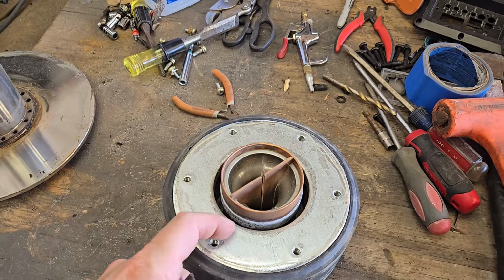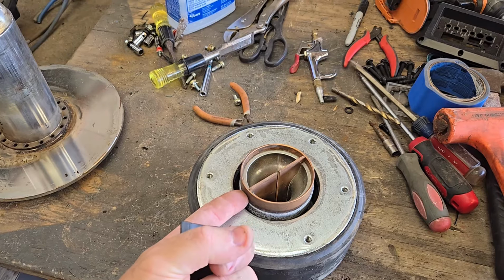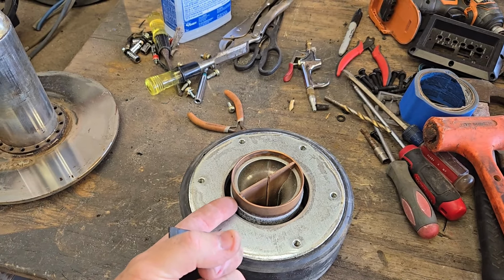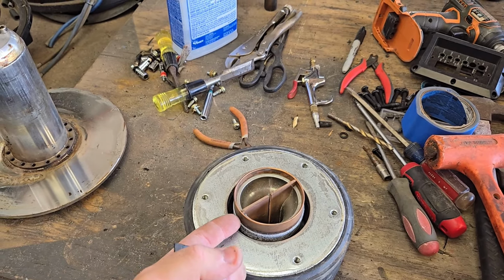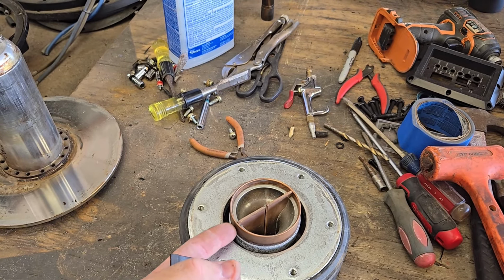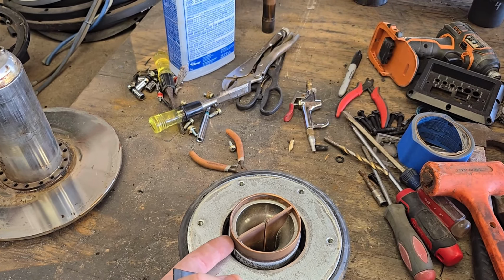As far as float goes, the smallest shim in the industry is JL Audio, and it's not a good thing. They cheat by using Kapton, which is a reinforced fiberglass former, so even when they rub, they don't really make a noise, or they make very little noise. And so I don't recommend using a gap like that. I recommend using at least 0.5 millimeter, if not 3/4. The standard is 3/4, and then no larger than about 1 millimeter.